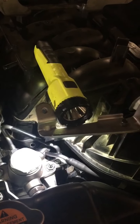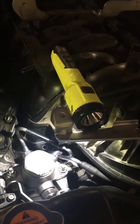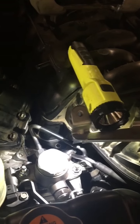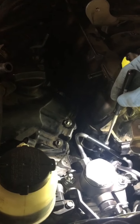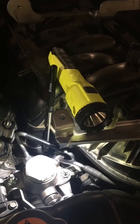I know this isn't an intake manifold removal/installation video — I have that linked and it's covered in other videos — but here are some tricks. There are really only three or four tricky things with the intake manifold. One of them is that some bolts need to be dropped into tight spots. What you can do is get yourself a telescoping magnet so you can drop those bolts right down to where they need to go without risking dropping them into the V of the engine.